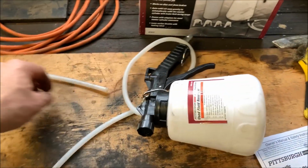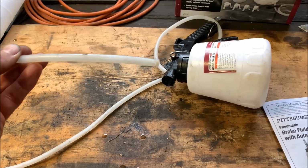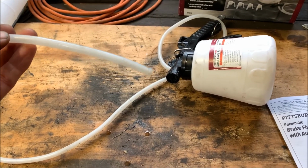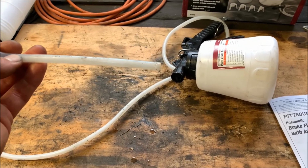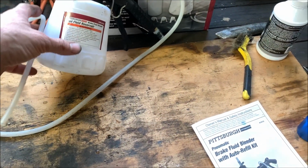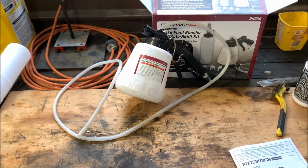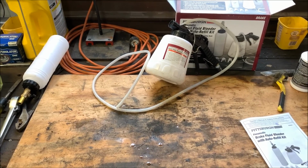One thing I noticed was kind of funny is when I was bleeding the brakes, on one of the rear wheel cylinders and then on one of the front calipers, I had been pulling some fluid through, trying to wait for the air bubbles to stop. And it just kept getting air bubbles, and I had pulled enough fluid through to bleed the lines probably 3 times. So I just closed the bleeder and left it as it was and took it for a drive, and it was fine.